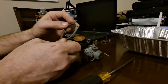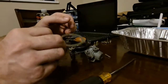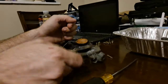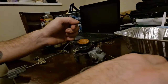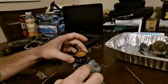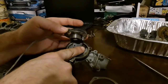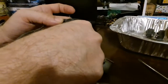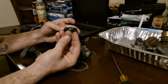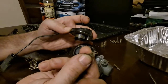To get in here, you'll remove the heads of those screws or pull the screws out and pull this off. The side with the number at the top stamped in it is the side that the factory has facing out — and that's how this will go together. When you pull this apart, be very careful because there is a plastic bushing in here. This insulates the circuit from grounding out through the choke linkage rather than the body of the choke.